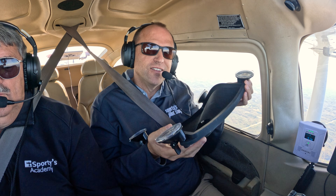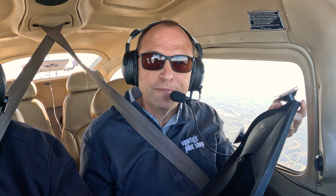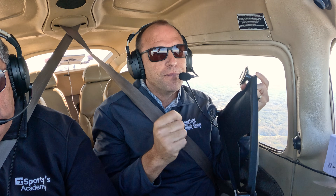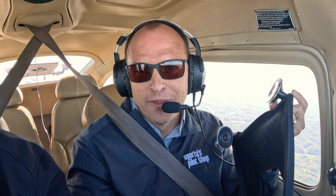Even on a 172 you can put this in that side-back window. When mounting your Starlink, you want the receiver faced as flat to the sky as you possibly can. We've tried mounting it vertically on side windows and we don't get near as good reception. This becomes an issue in a Piper or a Beechcraft Bonanza where there isn't a window pointing upward, so you have to get more creative. We've seen pilots put these on the dash, maybe on the co-pilot's side facing upward — great reception up there. We even had a Bonanza driver put it at the very front of the windshield in front of the compass. He had phenomenal reception, but his compass didn't work anymore.